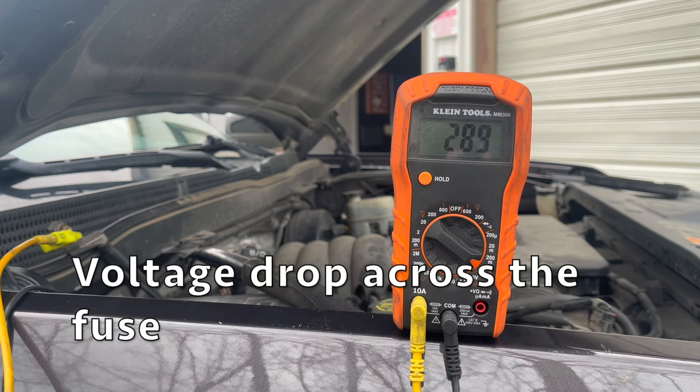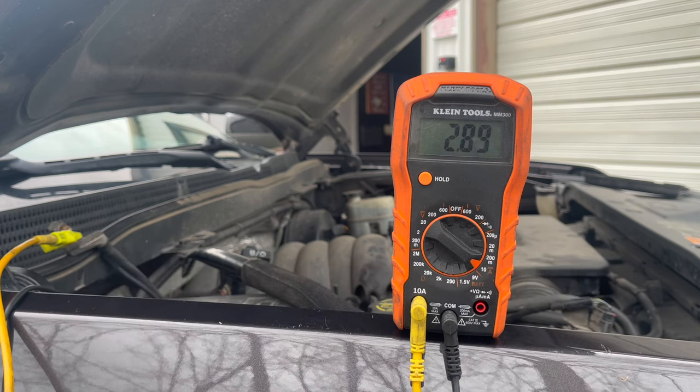I'm just going to do it old school style right here, and remove some of the BCM fuses to see if the draw drops down. But we're going to let this go to sleep, so I'm going to leave it for a good couple of minutes because we really want it to draw. Especially since the customer said it dies really quick, I'm expecting these 2 amps to be steady. That's around what we want to look at, 2 amps.